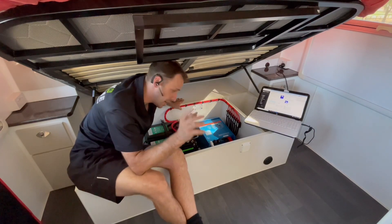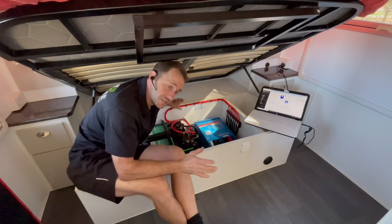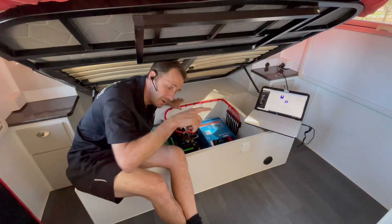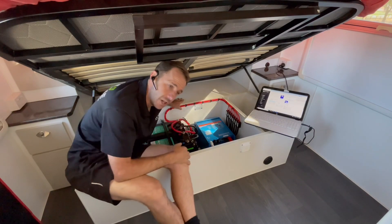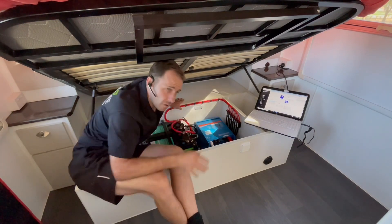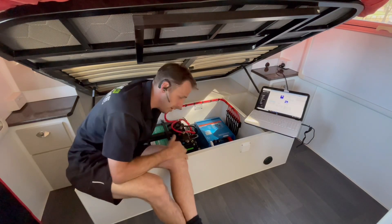We're going for fridge temperature monitoring on this as well. Little sensors inside the fridge showing fridge temp, and that's on the VRM portal too. So it fully logs the temperature over time. I can see if he's driving along whether the fridge — because it is a three-way fridge — is maintaining its temperature on 12 volt, which I've also gone over and repaired.